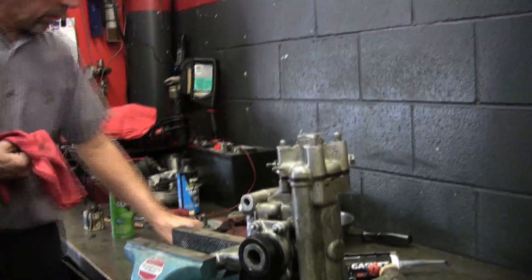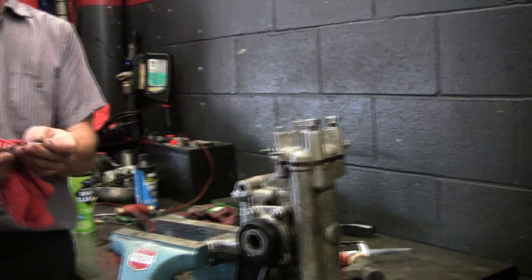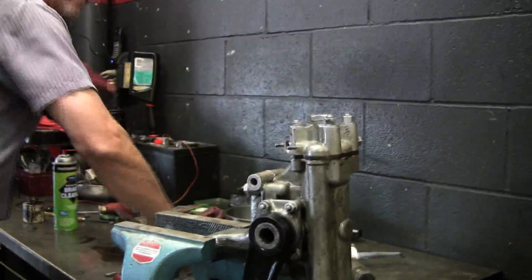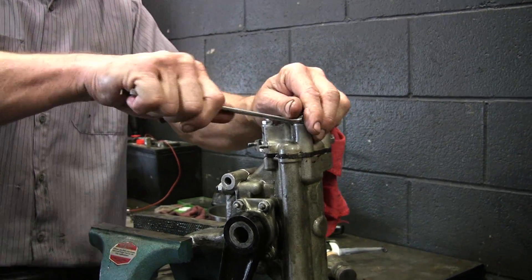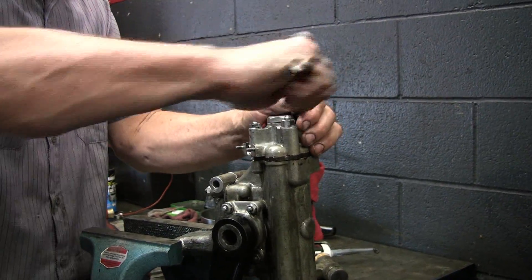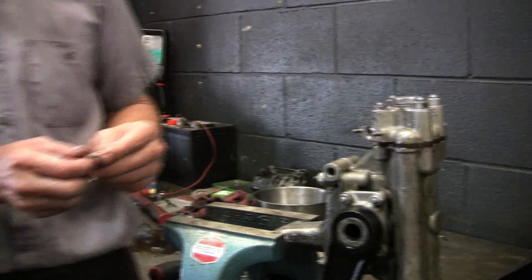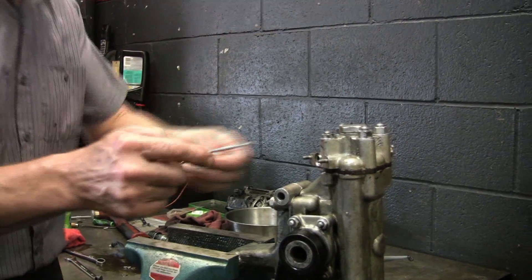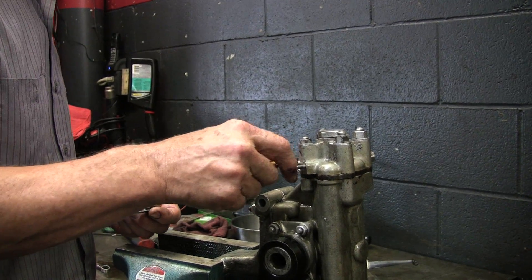That piece that slid in and out — they don't go on the plate, they go on this housing. These are 3/8 bolts, so they're about 30 to 35 pounds torque usually. Why is that a smaller bolt? It also helps prevent incorrect assembly, but it's probably just because they needed the space. If you recall, this valve went in first and it should be spring-loaded — I feel the spring now. Let's spring-load it.